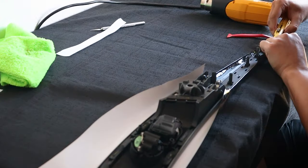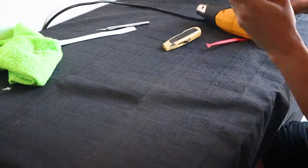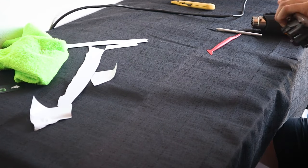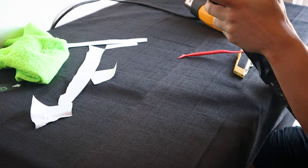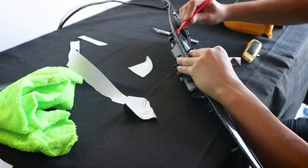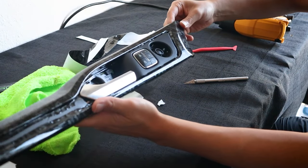This piece wasn't very difficult after the inlays were placed. The other things to account for were cutting out the center section covered by the smaller trim piece and the door handle to speaker area, but cutting with ample space to tuck the vinyl in rather than right on the crease made it super feasible. Lay the vinyl down, get it flush with the main surface area, then press it down on the back to secure a hold. This piece took the longest to wrap but it's more about size than difficulty. The cuts don't need to be perfect — they just need to cover the edges, and the abstract forged carbon glossy look hides imperfections really well.